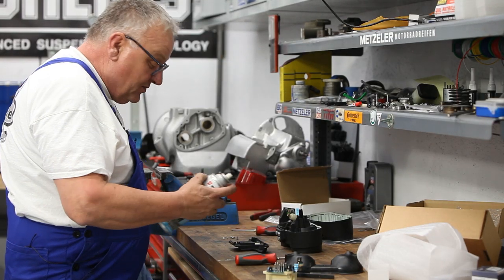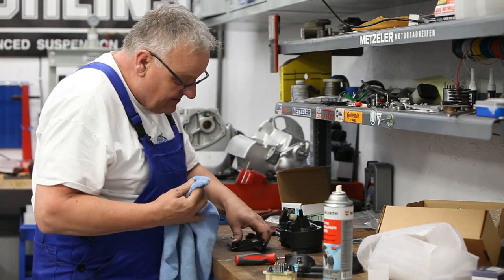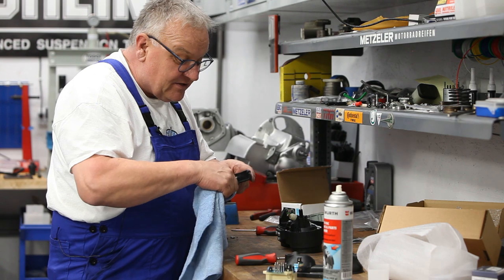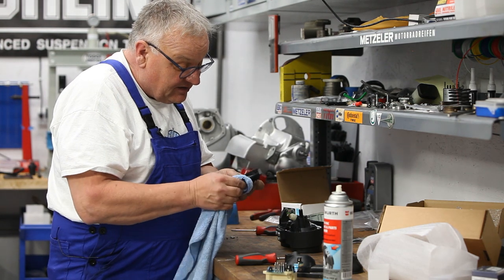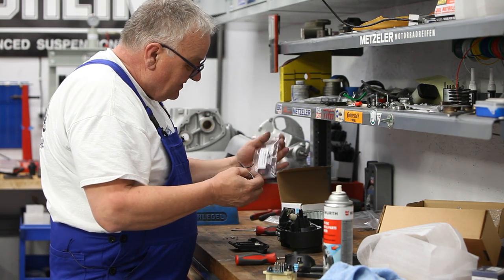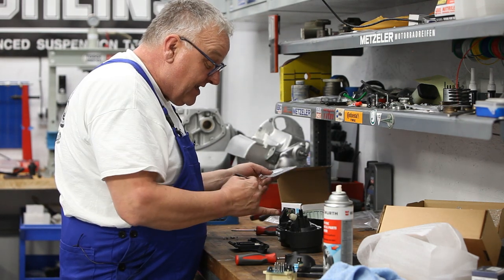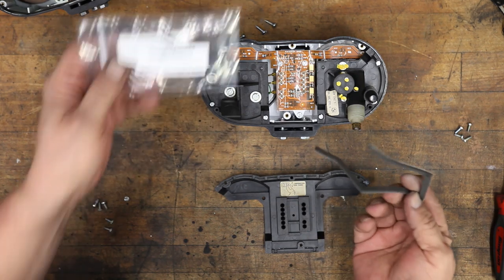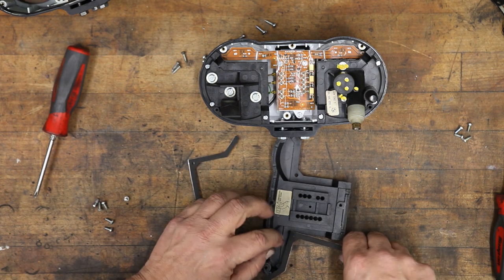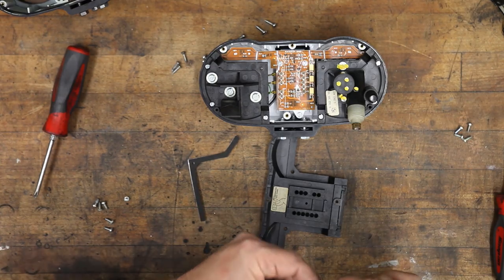Let me take some brake parts cleaner, just very sparingly, to clean off the glue residue on this part, just to prepare the surface for the new seals that I'm about to install. So we'll have an extra outer gasket. This is part of the gasket set, which contains the outer seal ring that we just installed, and these two other parts here sold as a set. So it's a very simple thing to do, just install it in this area. So we'll just do that.